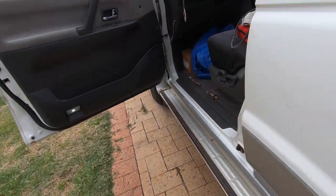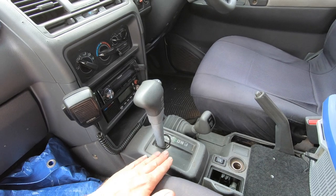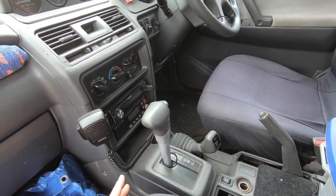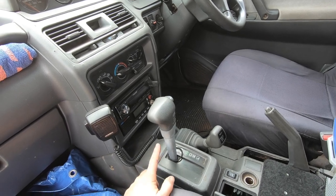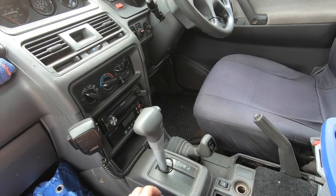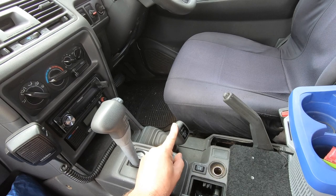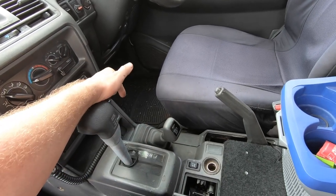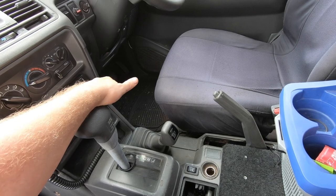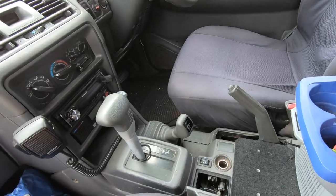Other things we need to consider: the gear levers — obviously the body's coming up so the gear levers are going to sink effectively. On a manual you've got a bit more work to do; on an auto not too bad because this is cable operated. The kit I've bought actually comes with a two inch extender for the transfer lever. There's also some wiring under here which goes through the body, so we'll have to pull the grommet and possibly re-route that wiring — that's not too difficult.